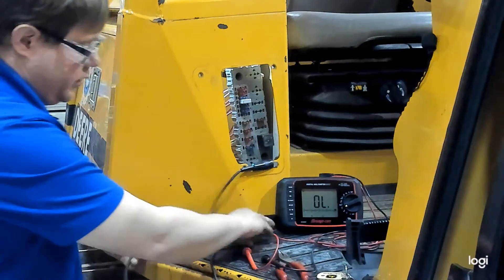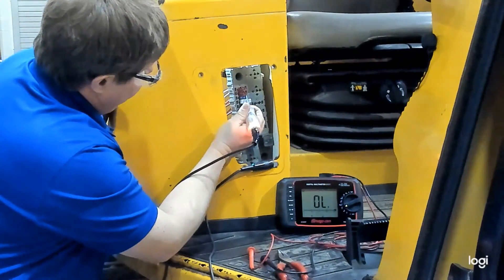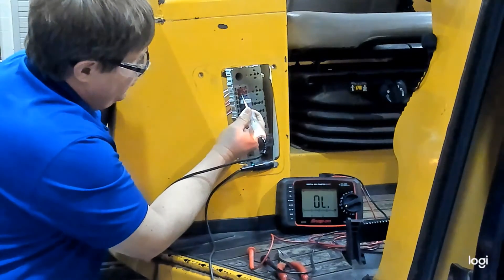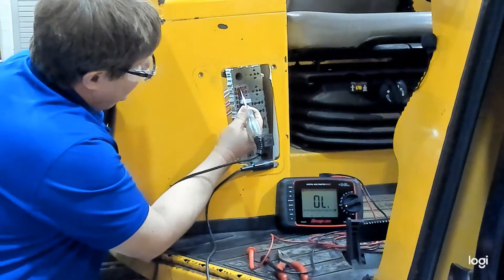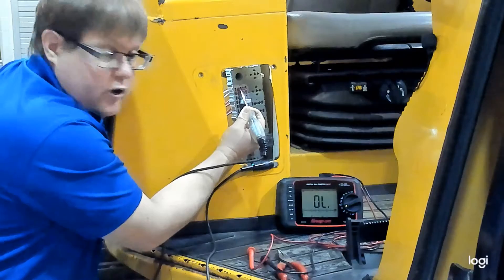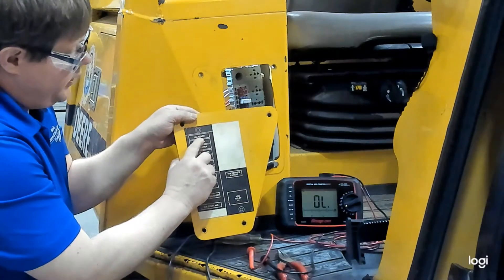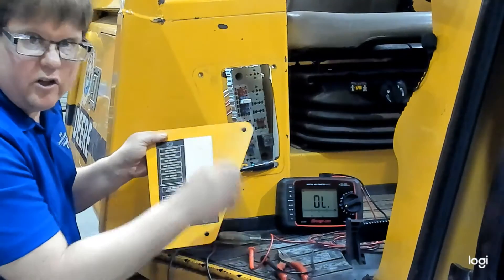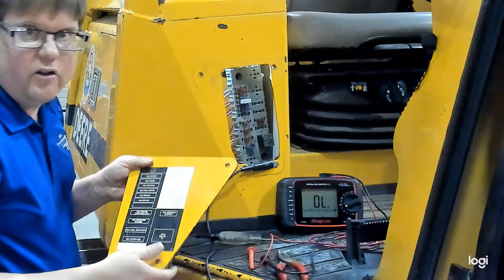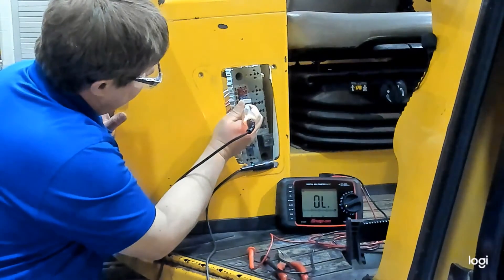It will require having the key on, so we're going to turn just the key on and go through and test our fuses. If a fuse has power on one side, it should have power on the other side — that's an indication of a good fuse. Now this first fuse that we tested, you'll notice that I don't have power on either side. That does not mean it's a bad fuse; that just means that circuit is unpowered. If we go back, you'll notice that was our start circuit, so that will probably only have power when we turn the key to the start position. So for that fuse, either we would have to crank it and check, or pull it out and test it manually. For the others, you can go through very quickly — power on one side should have power on the other.